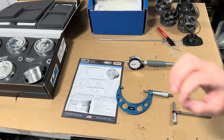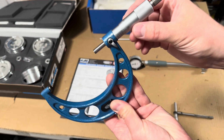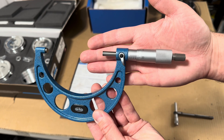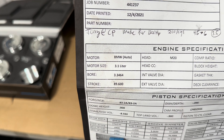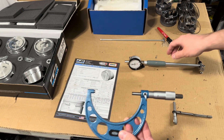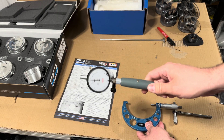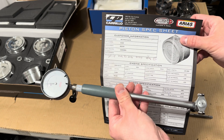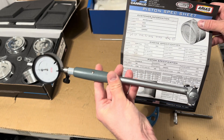I don't want to go over this in a ton of depth because you can find whole videos on how to use outside micrometers, but just to suffice: we're setting this up at the bore diameter called for on the spec sheet — that 3.3464. That's exactly what I've set this up at. With the dial bore gauge, you're just zeroing it out at the desired bore size, so that when you go to measure you can see if it's over or under. You're basically just setting your bore size as a target.